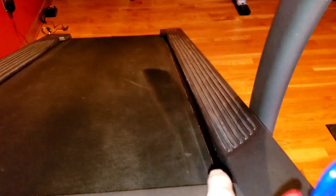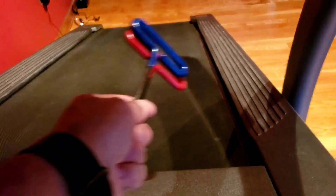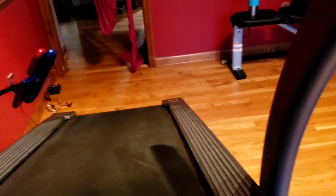It tells you to go in there and loosen those screws — by loosening them you'll actually be able to provide more give and it won't stretch the belt so much. The problem is, if you have this too tight it could actually damage the belt. Looking here with the flash on, the belt doesn't look too bad — I've had this almost two years — but on this side it looks like the belt has a little wear and tear. So I'm going to loosen it. When I loosen it, it may veer left or right, and if it does I'll go back and make micro adjustments.